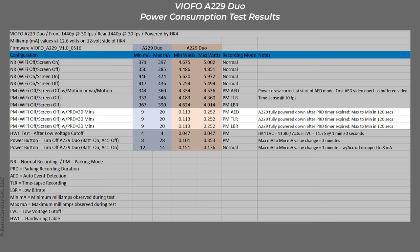The next three tests are related to the parking recording duration timer for each of the three parking modes. The timer is set to a predetermined time you want to allow the dash camera to run in parking mode, and after that it powers down the dash camera. After the 30 minutes I set it to, it powered down and initial power draw was at 20 milliamps, tapering off to 9 milliamps after about 120 seconds. There was a claim online that it should go into a super saver power mode and be able to awaken by impact or motion events, but I could not find that behavior present in this dash camera at all — it simply powers down after the timer expires.